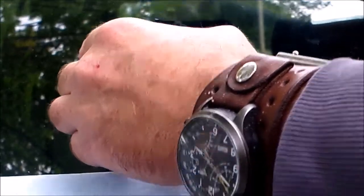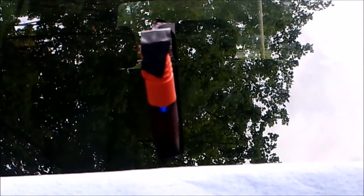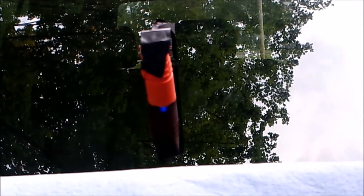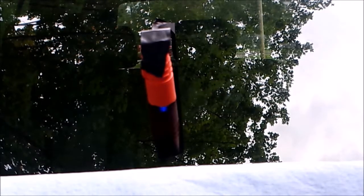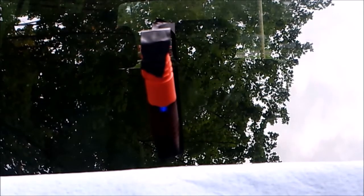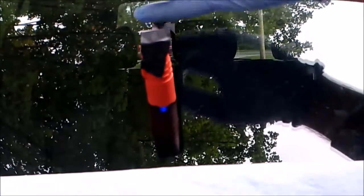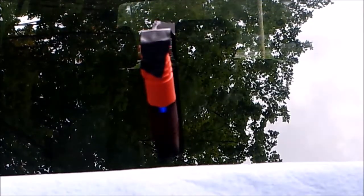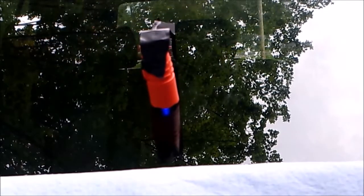I'm going to place it over the crack. I don't want to sit here for 5 minutes holding it over the crack, so I'll put a piece of tape on it and hold it over the repair for 5 minutes. I'll just leave it for 10, it doesn't really matter. And when we come back, we'll clean it up and see what it looks like. But, you know, supposedly you can let this cure for about 10-15 minutes in direct sunlight or use the UV light for 3 to 5 minutes. I'm just, like I said, gonna leave this for like 10-15 minutes directly over top and let it cure. Back in a bit.